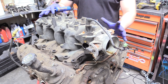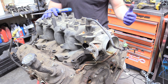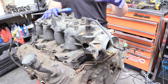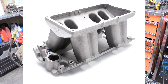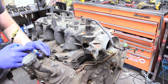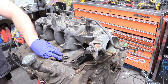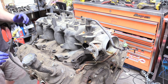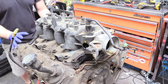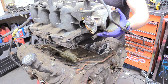Before we remove this intake manifold, you might be wondering why it kind of does this loop-de-doo arrangement. Basically, GM and a bunch of other manufacturers figured out that if you make the intake runner longer, it helps with air velocity — more air gets crammed into the intake side so you can burn more fuel, make more power, and it helps efficiency. Think old school tunnel ram on big blocks back in the 70s — that's what this is, just kind of wound up. With all our bolts removed, find a spot to put a screwdriver in. It's made of plastic so be careful. Just rake it loose and we can lift it off and set it aside. Since this is a full rebuild, don't worry too much about crud getting down in there — everything's going to be power washed and cleaned very thoroughly. Just don't drop a bolt down there, because you're going to have to go fetch it.